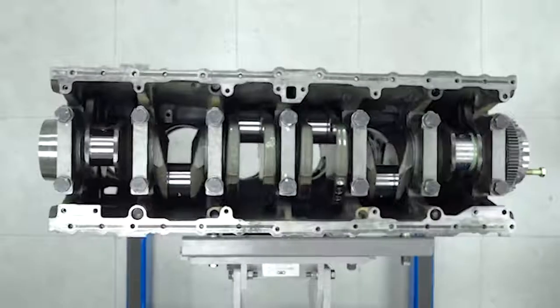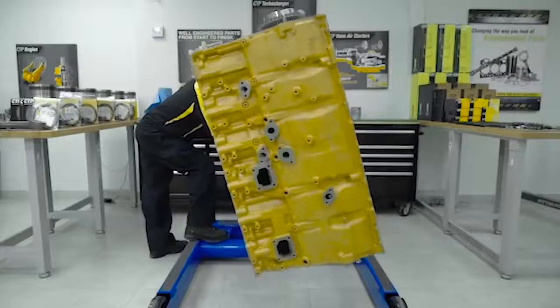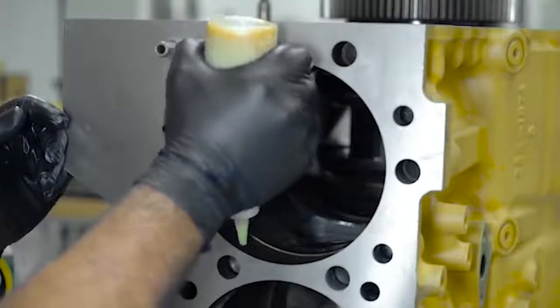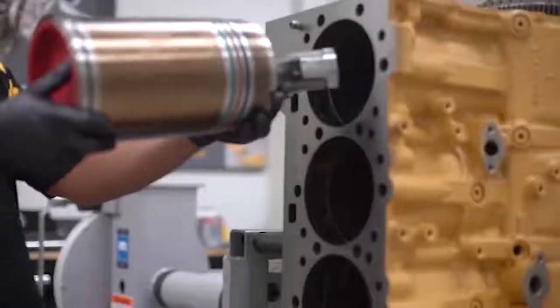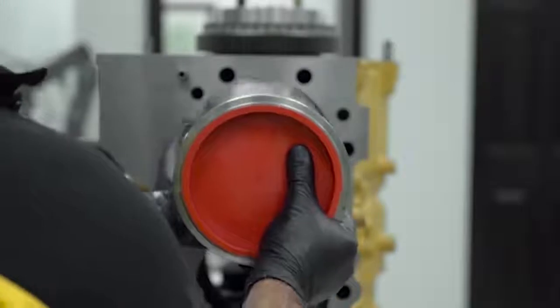We will now rotate the engine block. Normally, a Conrod would be assembled on an engine that sits inside the frame, that is, with the block deck in the up position or horizontal. For this video, to better illustrate the assembly process, we chose to do the assembly in the vertical position. We apply lubricant to the upper band seal area on the block. The technician starts to insert the connecting rod assembly into the engine block.